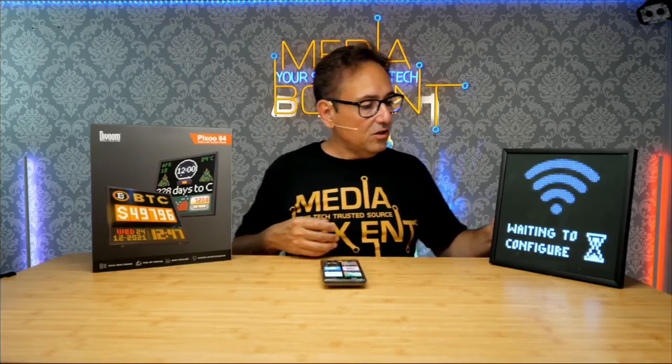Alright, so we are ready to configure the display. When you get it out of the box it should display a connecting or waiting-for-connection screen. Just in case it doesn't, hold the power for eight seconds — after eight seconds you're gonna hear a beep and then that's what it shows. We're gonna click in the left corner of the app, click Add Device, pair to the network, then enter the password. Remember it needs to be 2.4 GHz. Click next after you enter the password and it's already connected — how simple can that be?